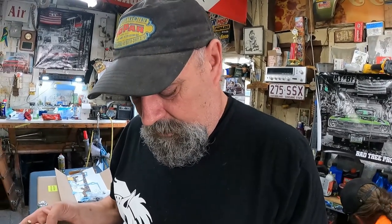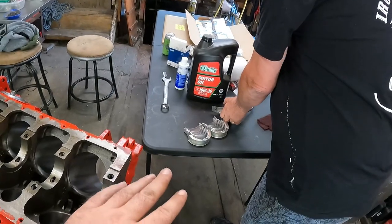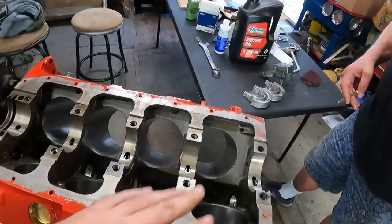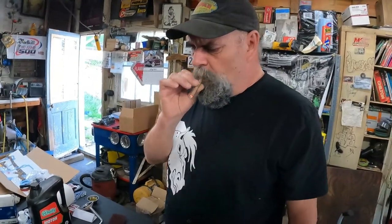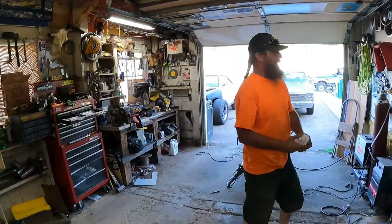Okay. Did you take this apart or no? These need to be torqued too, but we should look inside of it, right? Look at everything. Right now we're gonna slam our bearings into the crank journals here. Jay's gonna run and grab some plastic gauge, and we're gonna just check. We could just throw it together, but we're not gonna do that.